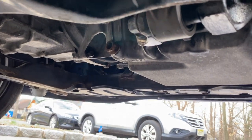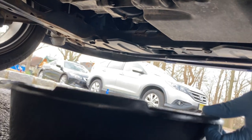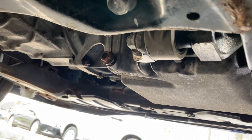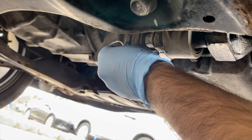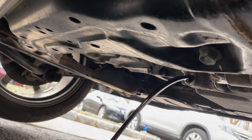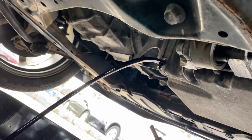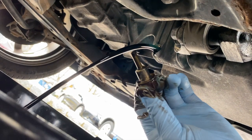Still underneath the engine, I was able to confirm this is loose — it says engine oil, so we're good. Make sure you've got your catch pan ready, because whenever you loosen this it's just going to spew out. You don't want to spill this stuff on your driveway — it's super slick and you'll have a big mess to clean up. And you can see how black this fluid is. I don't know when this was last changed; I've driven the car about 500 miles from Ohio to New Jersey on this fluid, so I'm glad I'm doing this now.